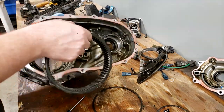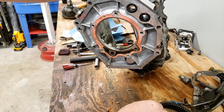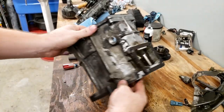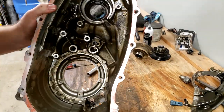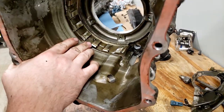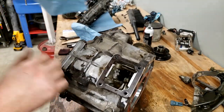There it is. All right, now that we've pulled this ring gear out of this case, the last thing we still need to take, it says, is a detent pin right here for that ring gear. That would be the one right here that has a little ball sticking out right there that would be on a spring. So it wants that. It says it's going to get assembled into the new case.